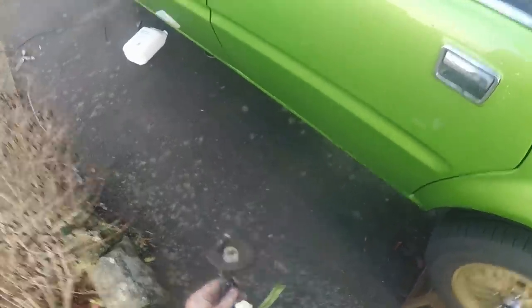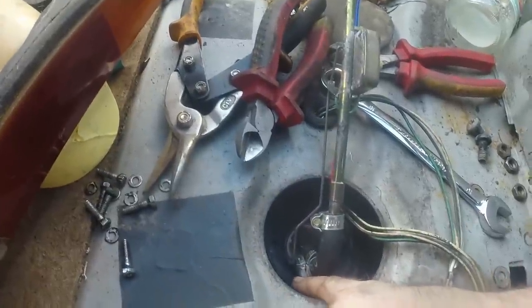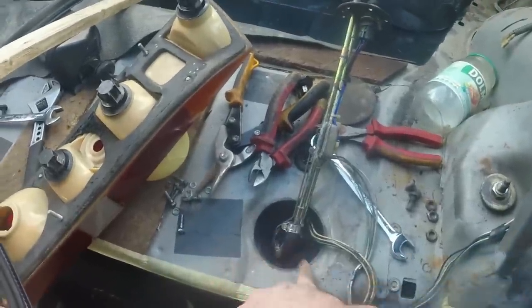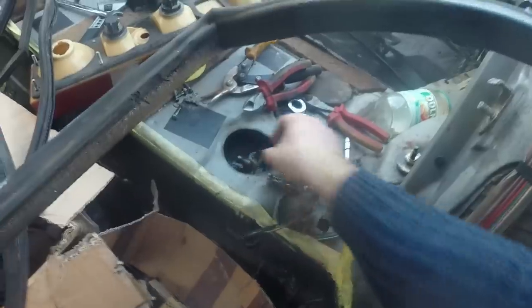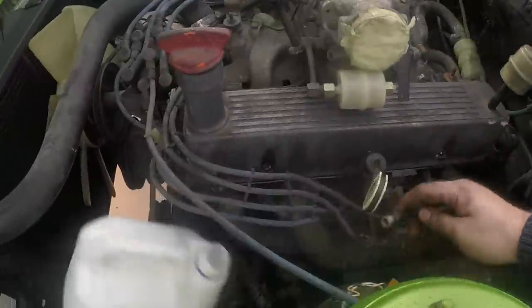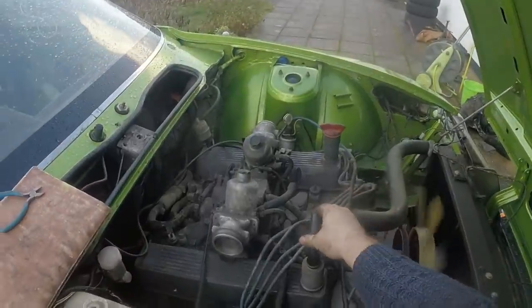Getting the pump back into the tank is an extremely tight fit — the clip was stopping me getting it in. I think what must have happened is either me or whoever was helping pushed it in and cracked the elbow. I undid the clip, rotated it out of the way, and tried again. Using the power probe again before bolting it all in — fuel coming out! It's all back together, the line is purged, and now I can work through the oil pressure side of things.